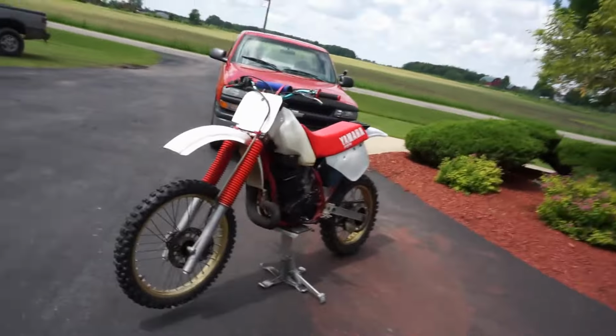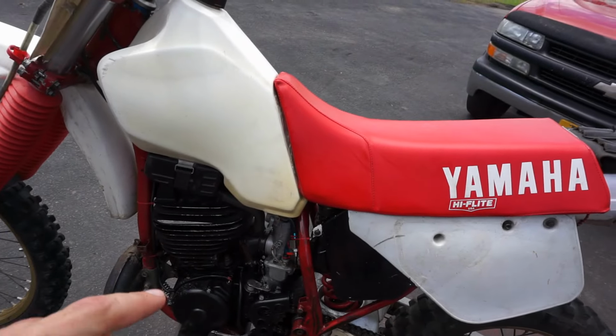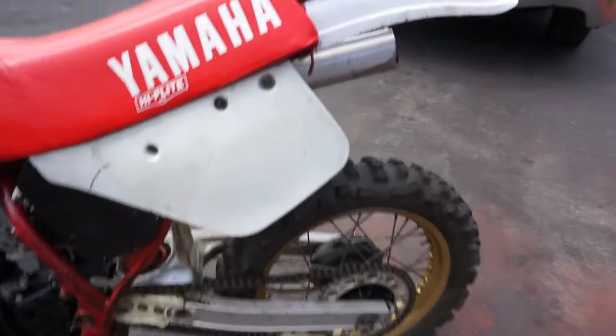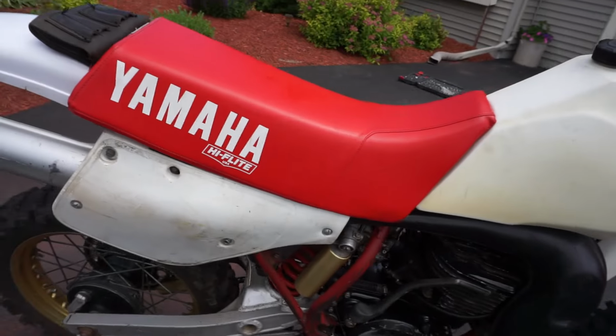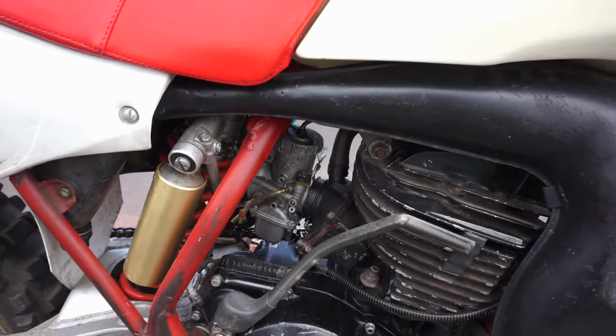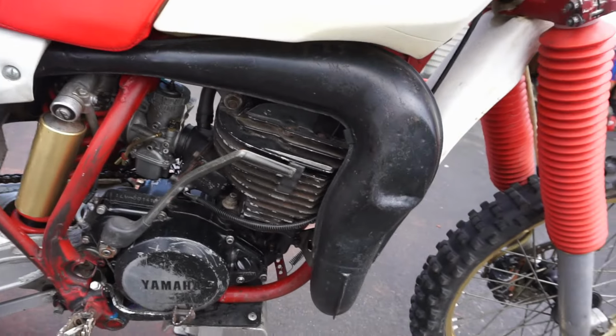Alright, so the plan with this thing next video: we're going to be taking off the carburetor, looking at the jets, seeing what's in there for jets. I want to look at the reeds, see what those look like. I might take off this back end pipe and see if that's plugged up a little bit, not letting enough air come through. We're going to check the air screw settings. That might be wrong. And I already checked the plug today and it was a brand new plug in it.